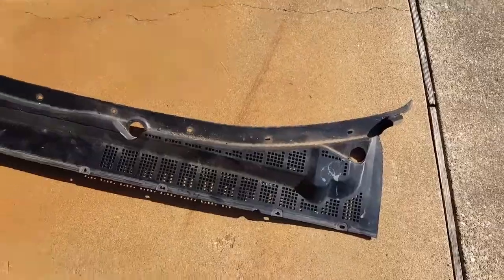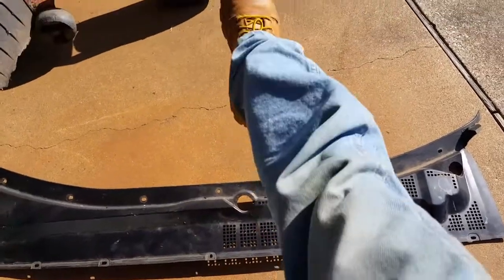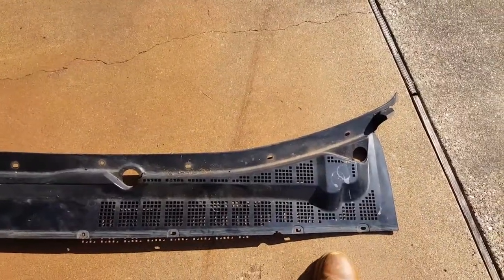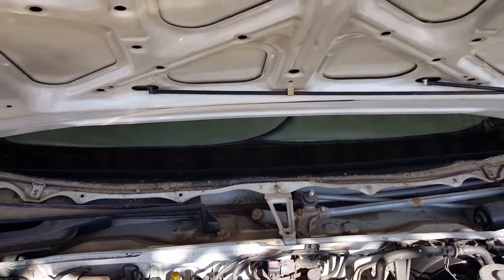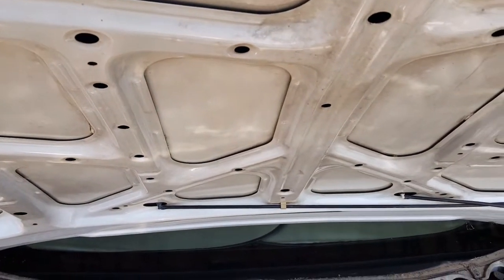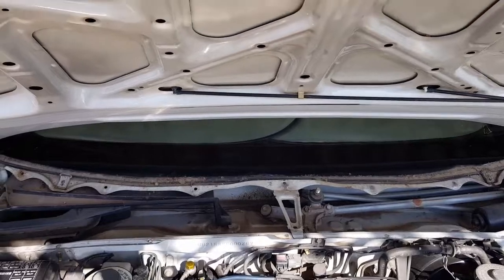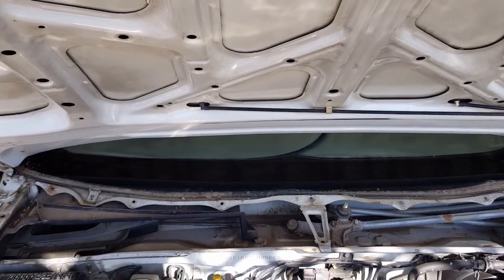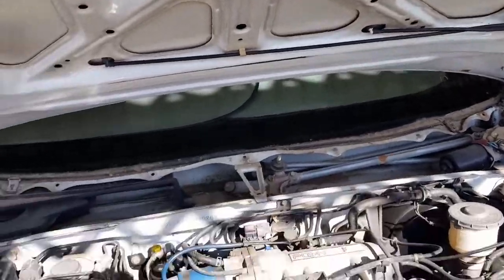This is how the corners are thin — it came out through the top. What I had to do instead of going straight up with it was lift one side — I lifted the driver's side — and turn it at a 45-degree angle, then slide it back over the windshield. It helps to have a friend hold the hood so they can move it forwards and backwards to give you enough gap to slide the cowl out.